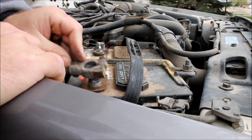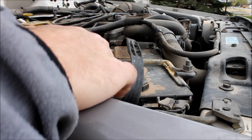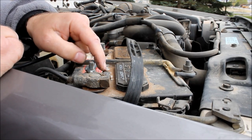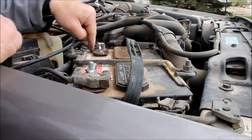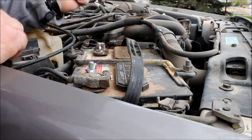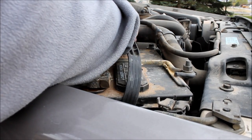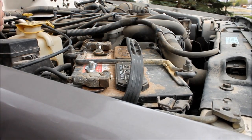Now we can put our battery terminals back over the top. Those battery terminals hold on these copper plates. We don't clutter up the terminal itself, and we get a much larger, in my opinion, area of conductivity with that big plate of copper. So I'm going to go ahead and put my terminals back on, get them all tightened down. And I'll show you how this wires up.